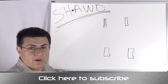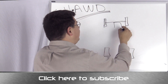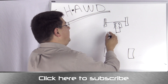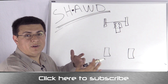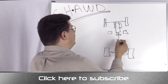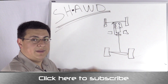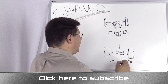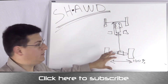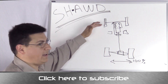Comparing this to a torque-vectoring rear-biased system like the BMW X5M: the X5M has its V8 engine sitting just behind the front axle, with the transmission positioned approximately between the front seats, and the transfer case sending power to the front when needed. The BMW X5M and X6M also have a torque vectoring rear axle and can send 100% of the power to whichever rear wheel they like. But crucially, in this rear-wheel-drive-based setup, the system can completely disconnect the front axle rather than the rear — meaning the X5M can have a decidedly rear-wheel drive bias, a torque vectoring axle, and still maintain a near-perfect 50-50 weight balance.